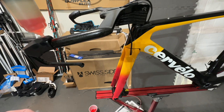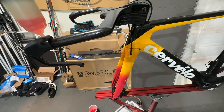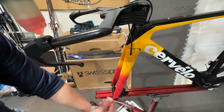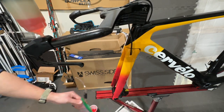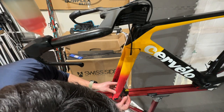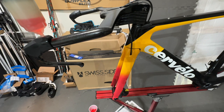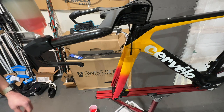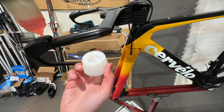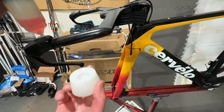So the first thing I'll do is make sure that the bleed nut is tightened, and then I'll loosen up the tube from below. And put this bleed nut cover back in place, and then on the top, I will put in the stopper here. They also have a stand like this, so there's a good way you can put the funnel when it's not in use.